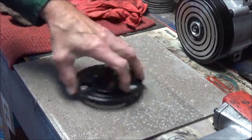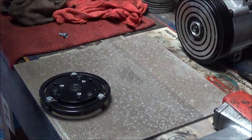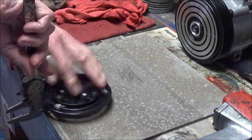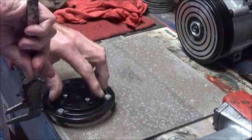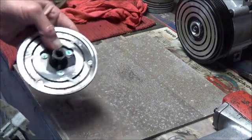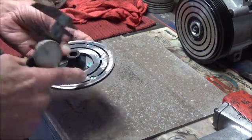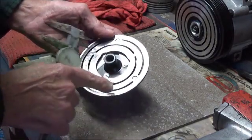It doesn't look like we can visually see anything there. I think I'll use this old piece of crap gauge — that may not be the best way to do it. Yep, we definitely have a clutch plate that's bent. You can see here, it's kind of hard to see in the light, but the inner scraping stops right about there and then picks up again right here. There's a good area right in here that it's scraping. So this clutch plate is bent down in here.